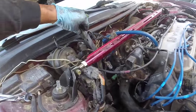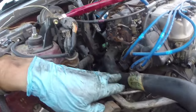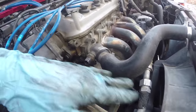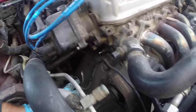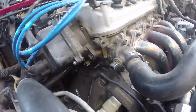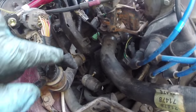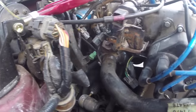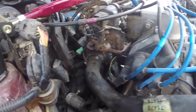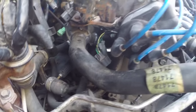What I did next, I went ahead and disconnected this whole part of the wiring harness. This comes through and connects to the external coil, the distributor, all the sensors in the front, O2 sensor, reverse lights — just to give me more room to work in here to get the bolts removed for the transmission, plus the mount and any of the cables for getting the car into gear. If you want to do that, it's really easy to take those off, but you probably can get it without doing so — it just seems a little more difficult.